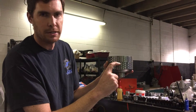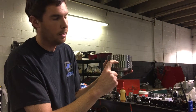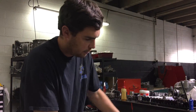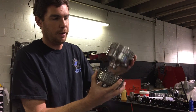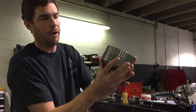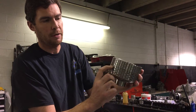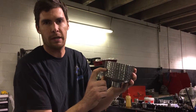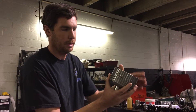So you always had issues on the last friction on top if you're trying to run a 20-plate, where it would actually roll over the splines. This new design is a little bit taller and curved on the end — you can see right here it wraps around the basket much better, leaving quite a bit more room to add that last friction to get as much clutch as we can out of the assembly.